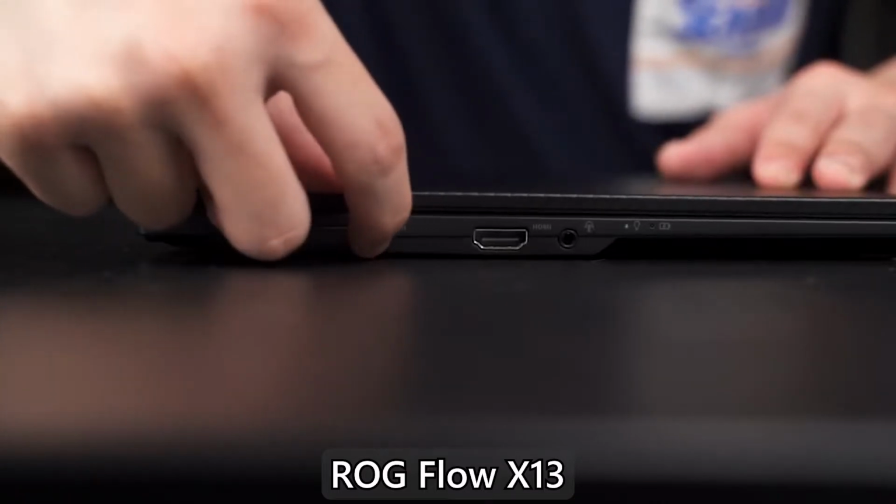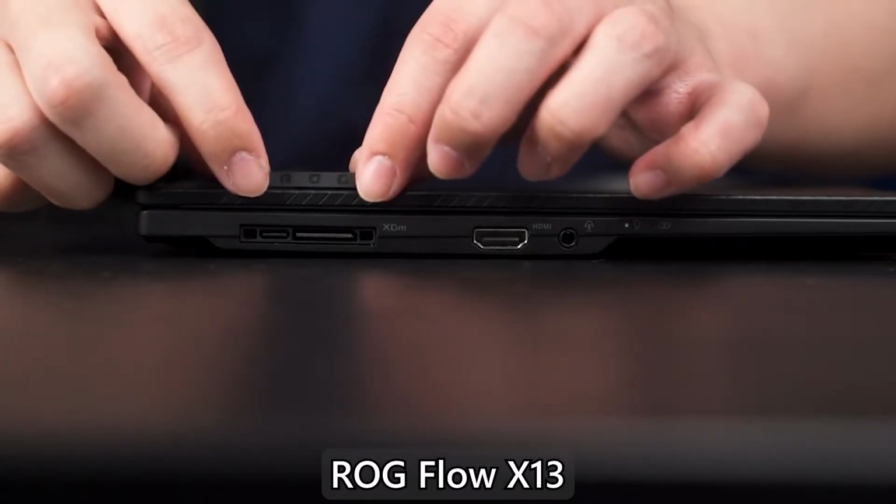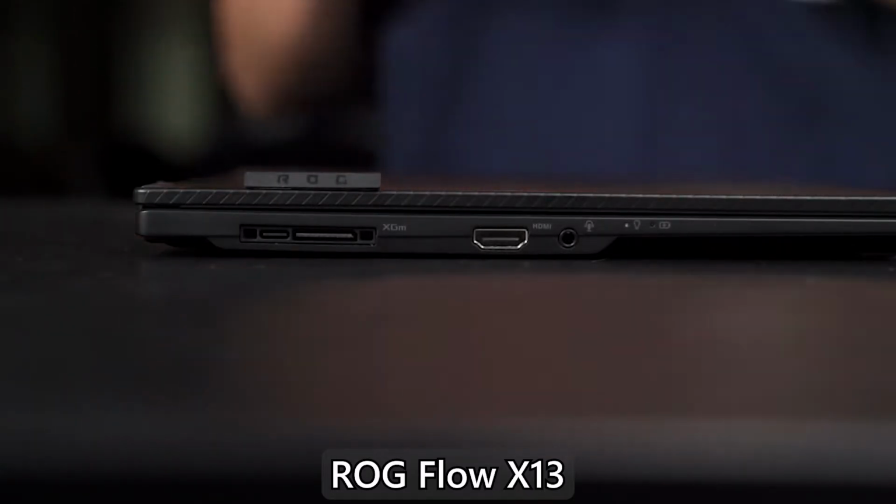And the reason they want to use this proprietary connector is the doubling of the PCIe lanes. This is 8 lanes compared to the usual Thunderbolt 4 lanes. However, even with all those lanes provided, the graphics card you are using here is just a normal laptop GPU instead of a full-fledged desktop GPU. Any other Thunderbolt-based external GPU uses desktop-class GPUs with only 4 lanes and they are still working fine. It's a plug and play solution, but this is not as elegant as that.